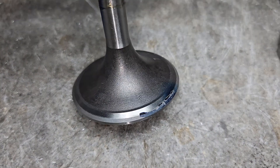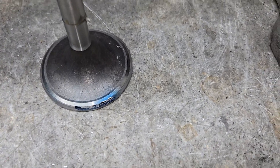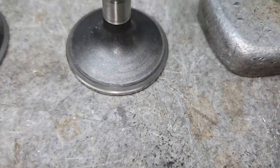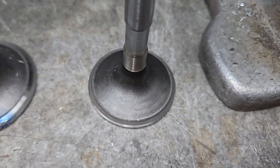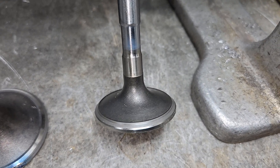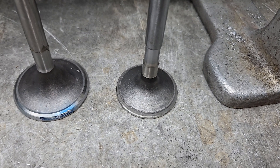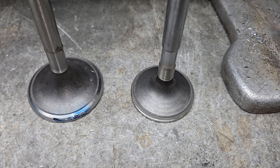This is like a stock replacement style valve. Not bad coverage on it. It does have a bit of an evaporation ridge, like most stockers do. And the exhaust also has an evaporation ridge — or an anti-reversion ridge, you could call it — on an exhaust. I'm not really opposed to that. It is slightly necked down in the 360 size.